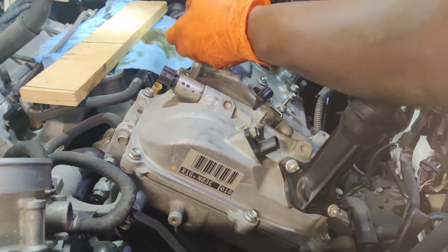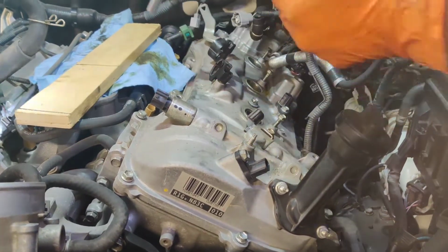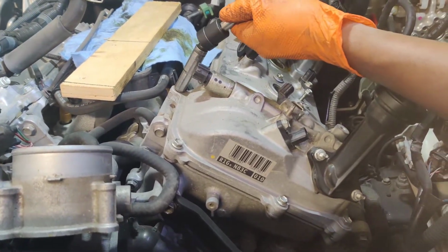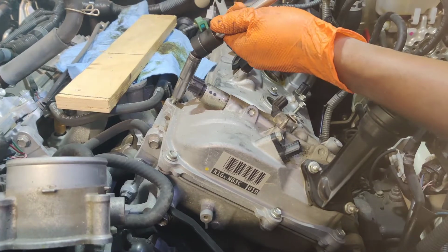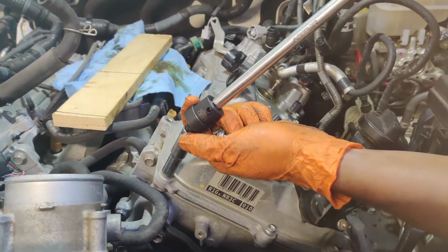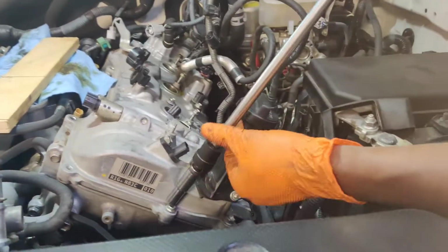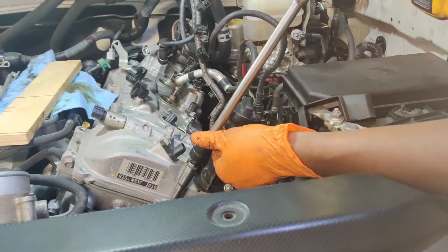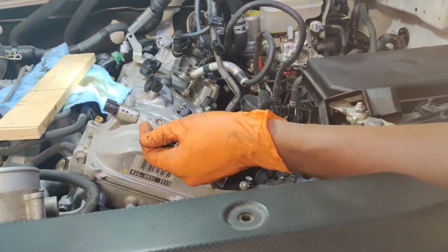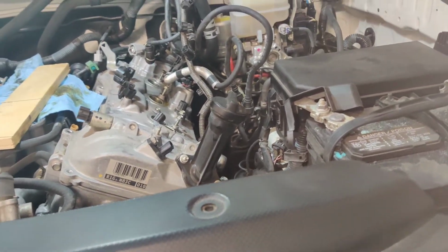So you have to go crisscross just to release it properly. Doesn't matter because the glue is there already to glue it down. I see. So it's not like it's depending on the bolts by itself. Now, if you're doing a head gasket, that is because there's so much clamping force. But these, I usually torque to less than 12 pound feet. Oh, that's not much at all. That's what I'm saying. So you don't really have to stress yourself with trying to move them in a particular sequence. You can do what you do, but.